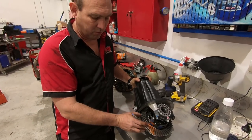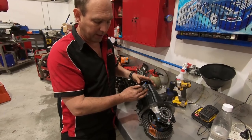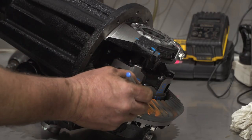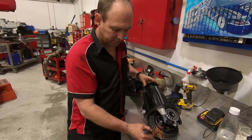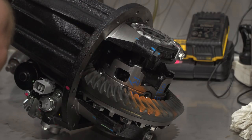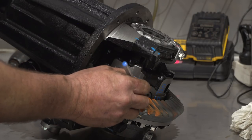This paint here is what they use in the factory to set up the crown wheel and pinion. You're checking two things with it. The first thing: when you put the pinion shaft in — it's got two taper roller bearings — you're checking that the shimming of the pinion is correct, so that the pinion is sitting in the correct position where it meshes onto the crown wheel. You see how the paint is being cleared away in the middle of the tooth — that's ideally where you roughly want it, as it's the strongest part of the tooth. If you've got too many shims, it will push all the way up into the taper and be too tight and bind. If you have not enough shims, it will pull the pinion away and it will be rubbing on the outside edge of the tooth — the lever effect on the outside edge is not the strongest part. So the middle area is the best area for the pinion to be sitting running against the crown wheel.